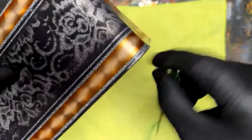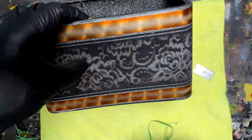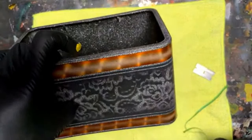But I'm just going to go ahead. This thing is so tiny. It's going to go in the booth with another part that I have, so I'm just going to send this into clear coat. Come back, scuff it down, fix those couple of areas, and then put it back into clear coat again, another 3 coats of clear or so. And then this thing will be ready to go. We're going to be ready to cut and buff this thing if we want.